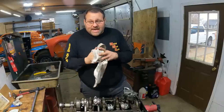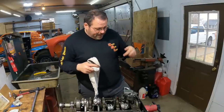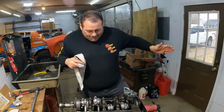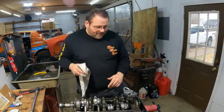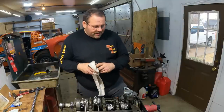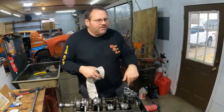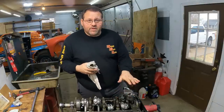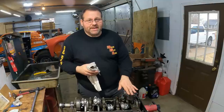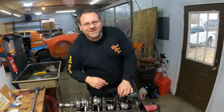Like I said, I'm probably going to take a half inch chuck drill and run down through the distributor hole and actually pump the system up with oil anyway before I crank the engine, before I stab the distributor in. But that right there is going to keep me from possibly scratching up an impeller, even when I'm taking a drill and doing it. And I'm sure when they put these together new, they probably have a lubricant that they're putting in them anyway. But better safe than sorry. All right, let's put an oil pan on it.